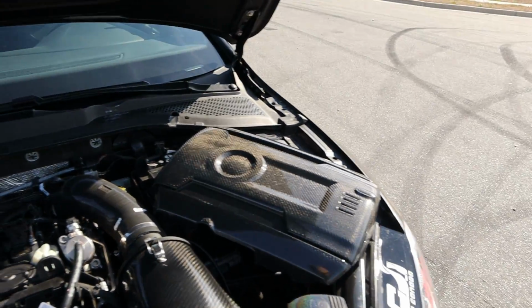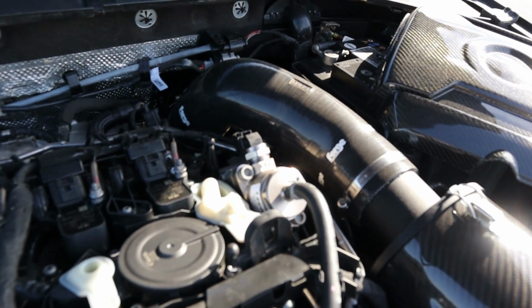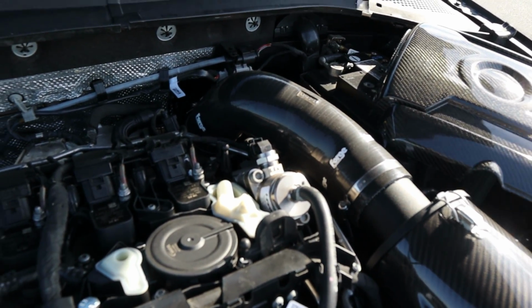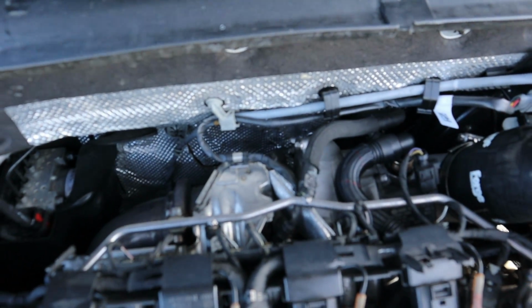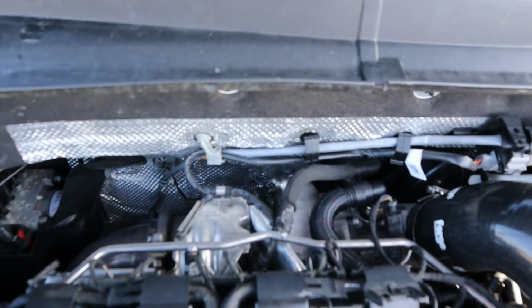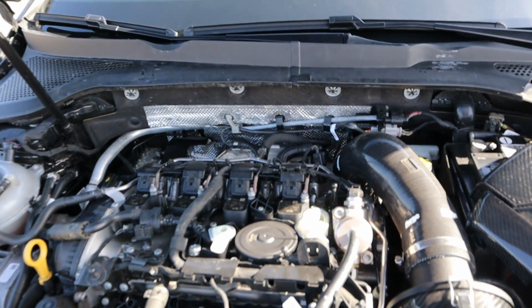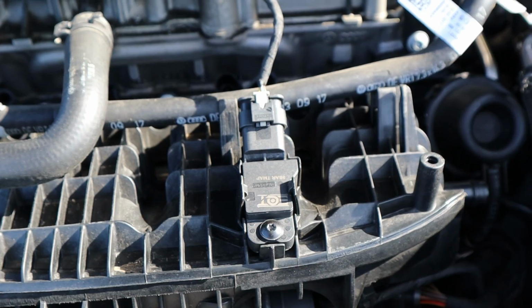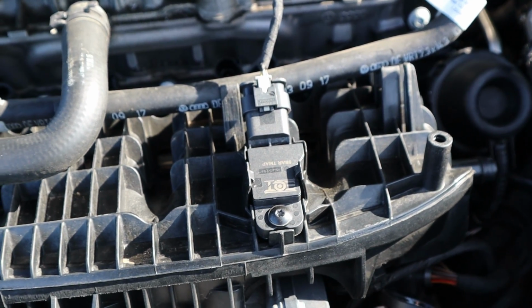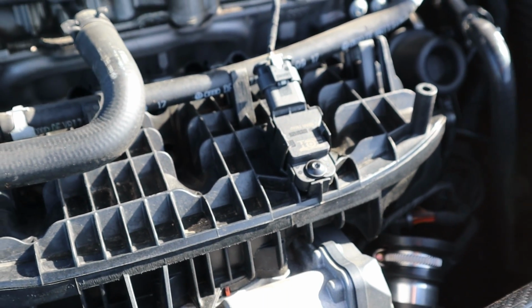And under our carbon fiber engine cover, we do have a HPA high pressure fuel pump right there, and that is paired with, right here in the back, a TPC 20 ball bearing. It is their brand new version of their turbo. Super good. It makes a lot of awesome noises, spools up pretty darn quick, and makes plenty of power. And as you guys can see, that is our EQT 5-bar TMAP sensor, and then we also have the 4 bars sitting down below on the charge pipe.